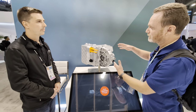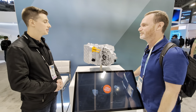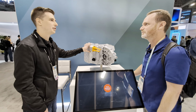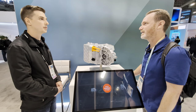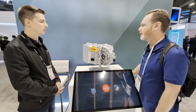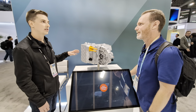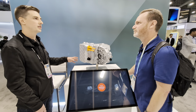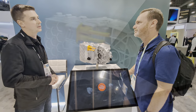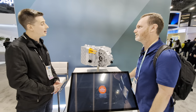This looks big here, but it's actually a compact design compared to competitors — this is industry-leading power density and torque density. The unit as shown in real metal is only 75 kilograms, which is pretty incredible. So 250 kilowatts in this package — you're not seeing it very often at the show. This is now not with a customer currently; we've finished our advanced engineering process, done all of our testing on the bench and demo vehicles. The next steps is to sell it to a customer. We'll be ready for SOP 2026 and onwards — maybe even a bit sooner if the right situation comes up.